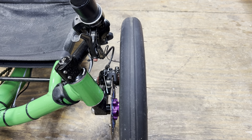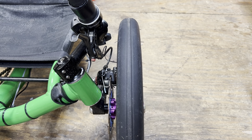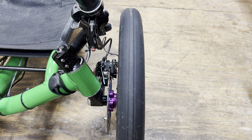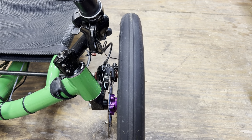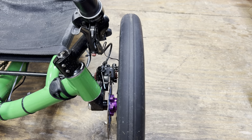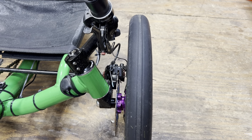More of a soft feeling brake — not as strong as the other types. The one I used most recently was the Sturmey Archer 90 millimeter on the Greenspeed Arrow. They heat up quite a bit too. You don't think of a drum brake as running hot, but if you go down a big enough hill and you're really hard on them, they can heat up quite a bit. But they are quiet, fairly quiet, low maintenance, low noise — even when they get wet, I didn't experience any squealing.